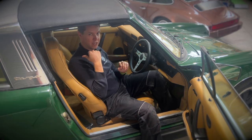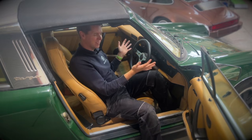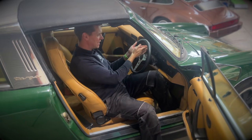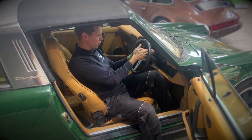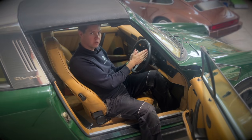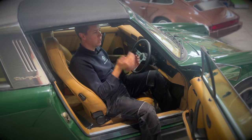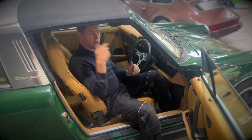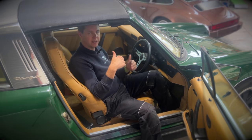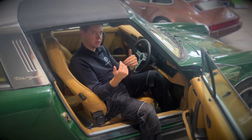So from the drive unit system, the battery management system, to show you electric conversion features as well. You've still got your speedo dead center. You've got your amps on the right here. That's telling you how much power you're using, but also how much power you're putting back into the pack. So if you were driving very quickly and then you slowed down, then the regenerative braking would put energy back into the battery pack, and that dial would show you how much that was.